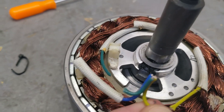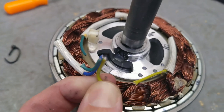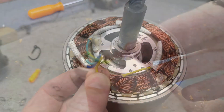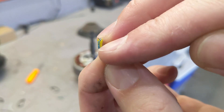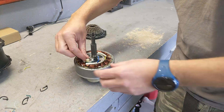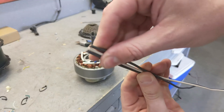They're cut but they just melted together inside the harness — they were one step away from a short. You can see the blue cable basically went to the yellow and just melted together. We don't need this piece of plastic either, so we're taking that out.